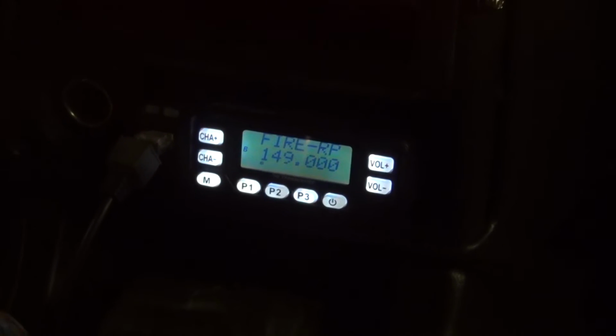On the A side of the radio, I've got the memories programmed in. They just display the text, not the frequency. I've got some of my fire and EMS frequencies programmed in to scan, and then I've got some of my local amateur repeaters, and then I've got MURS, FRS, and GMRS frequencies programmed in. And then on the B side, I've got that set up as a VFO only, so I can use the keypad to type in frequencies and use that in VFO mode.